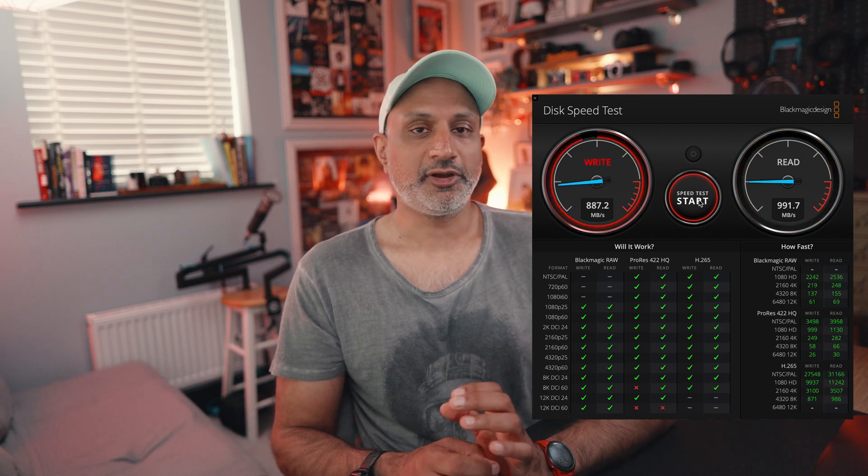So how fast does this thing actually go? After initialization I was impressed. The spinning hard drives gave me write speeds of nearly 900 MB/s and read speeds of nearly 1,000 MB/s. The SSD pool was actually less impressive — surprisingly, read and write speeds were very similar to, and in some cases slightly less than, the hard drives. I think with three SSDs at 500 read/write each in RAID 0 I was almost at the capacity of my 10 gigabit Ethernet anyway, so I'm happy with what I've got. This is more than enough for any video editing you'll throw at it. I've been editing 4K and B-RAW footage in DaVinci Resolve and it plays back in real time, full resolution with no issues. However, yesterday I did notice some slowdowns — no CPU or network bottlenecks were apparent — it seemed to resolve itself after a few minutes, but I'm keeping a close eye on it.